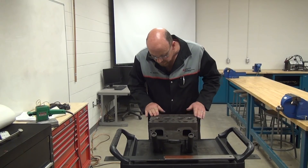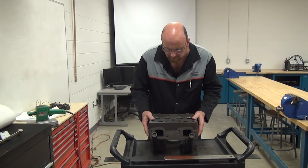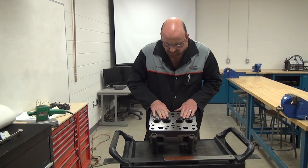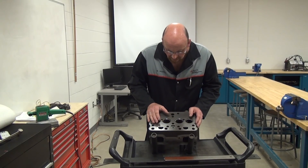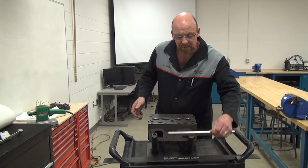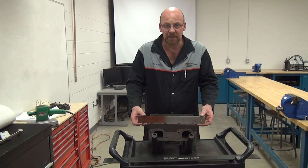I've taken quite a bit of material off — the dirt, debris, and rust that was on here. You can see that some spots are a little shinier than others. There is some rust pitting because these heads were used from a supplier and had sat for quite some time. I've done other measurements and inspections and the valve guides are good. The next thing I'm going to do is introduce a couple of tools: one is our short straight edge, which is perfect for this particular style of cylinder head. We're going to put it on the furthest most point out on the deck surface.